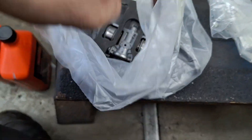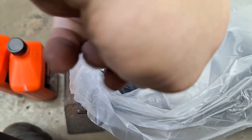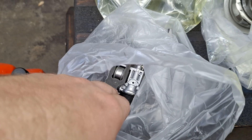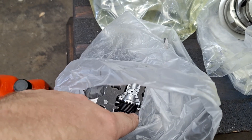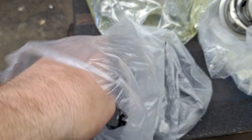The boot on the fork is in good condition. When people try to spray penetrating oil down in these — like if your fork is seizing — this boot will rot and get debris in there, causing it to stick even worse. So that's something to be aware of.